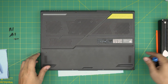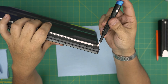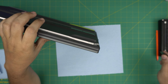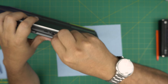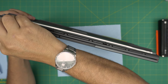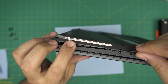Now for that single special screw — as soon as you start rotating it, you'll see the gap opening between the bottom cover and the palm rest. Keep rotating until you hear a few clicks, then stop. Now stick the guitar pick between the two openings and work along the front, just wiggling it around. You'll see separation between them. A big click sound is normal — that's the clips getting loose. Do that on the left and right side by the USB ports.